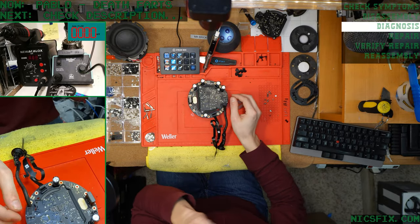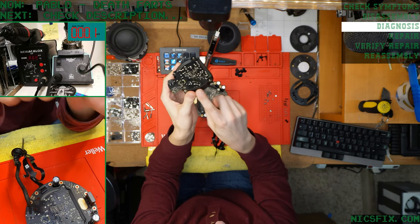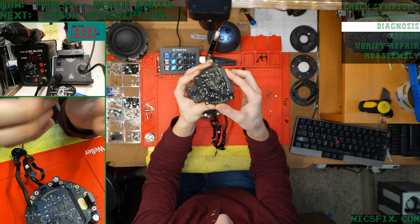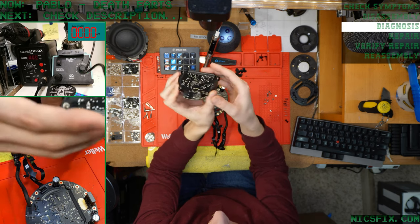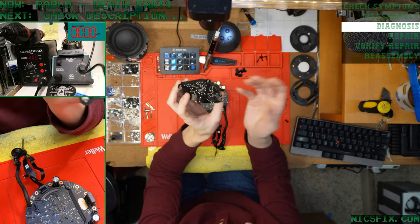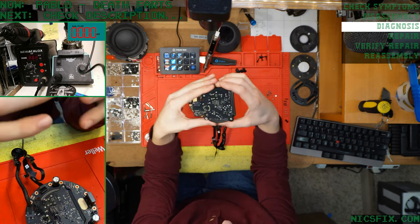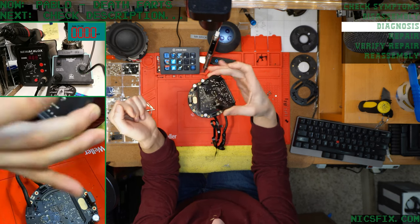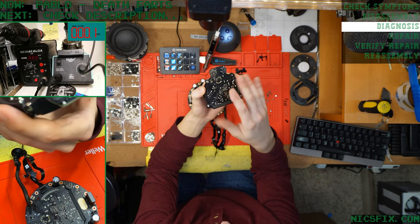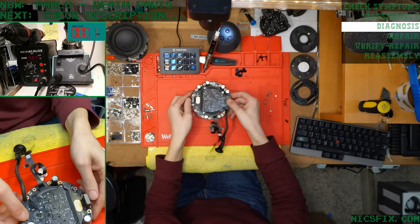Do you actually know where the power supply is safe to touch? Yes. Anywhere around the edge where this plastic is safe to touch, because it's plastic and it's not going to conduct anything up to a certain point. Anything becomes a conductor after a certain point, but nothing you're going to see come through this power supply, especially the caps here, is going to come through the plastic. Safe to hold the power supply by the plastic, pretty much is what I'm saying. I wouldn't suggest touching anything anywhere else. Don't do what I do, unless you know what you're doing.